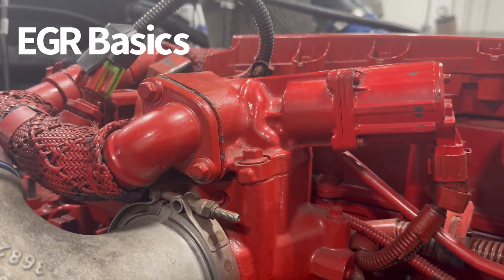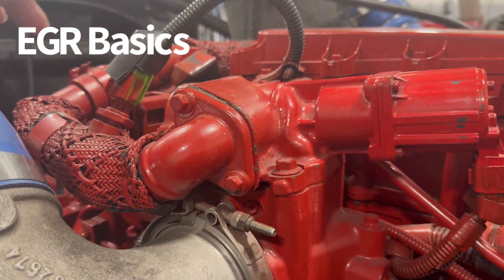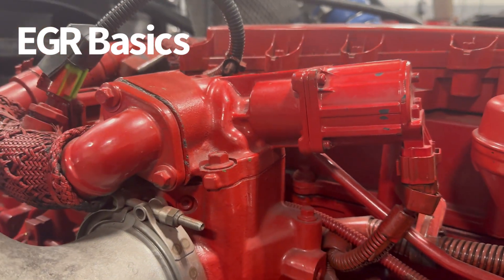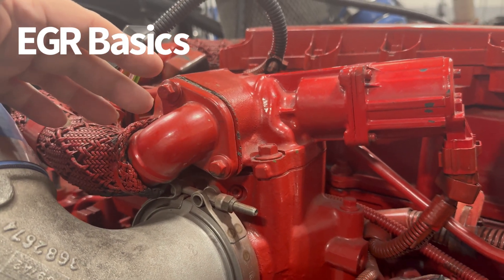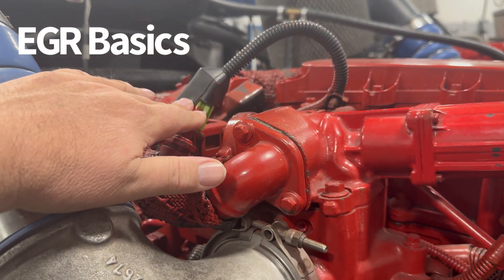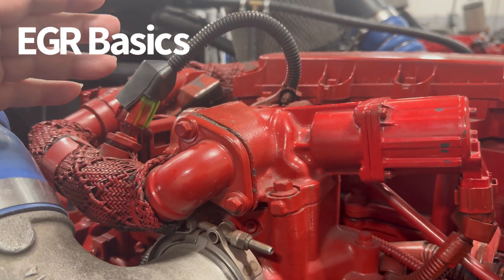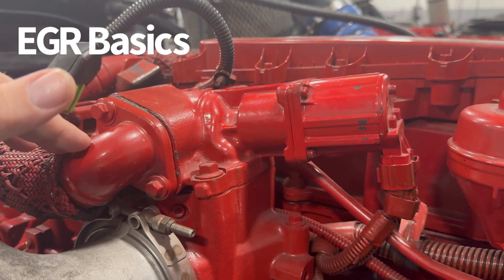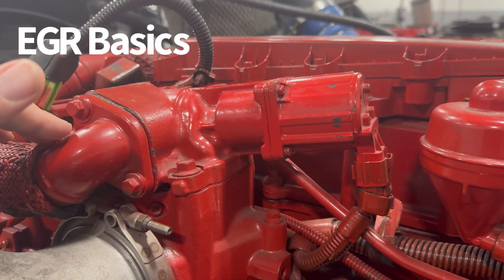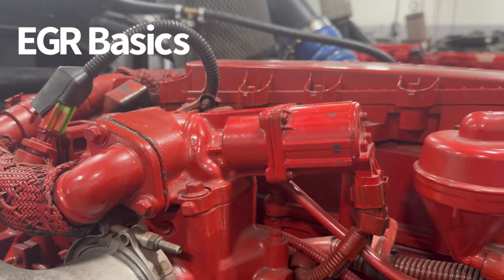There are also flow sensors in this system — we call them delta P sensors — used in the EGR because they measure pressure at two different points in the exhaust gas flow. That's how the computer knows how much exhaust gas it's recirculating, and it knows how to change the position of the valve based on that. I hope this video helped with a basic understanding of exhaust gas recirculation, or EGR, and what it does on diesels and what you can do to keep it healthy. Thank you for watching — please like and subscribe.